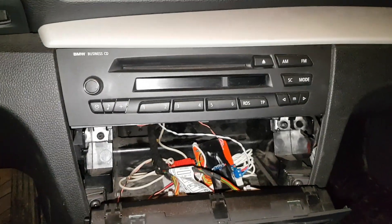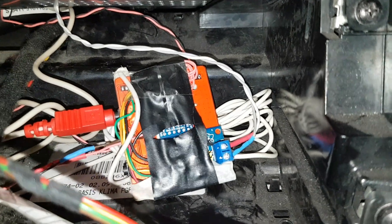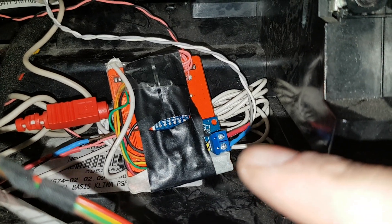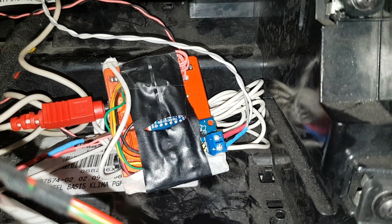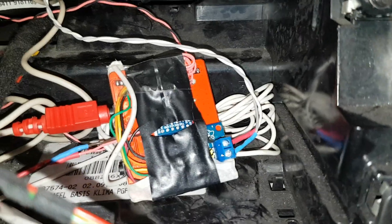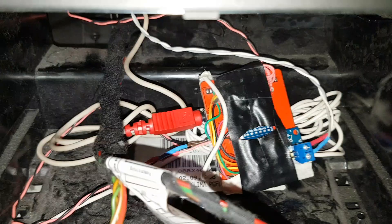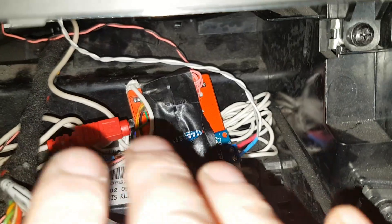Here is the assembly — not much to look at, but it's composed of an Arduino Pro Mini and an MCP2515, which is a little board on the bottom. On the top is the Arduino Pro, which I piggybacked on the Bluetooth board — it's exactly on the opposite side with some double-sided tape. That's the output, and it also has an input, but I didn't use it. I'm going to make a little foamy base where it can sit on.